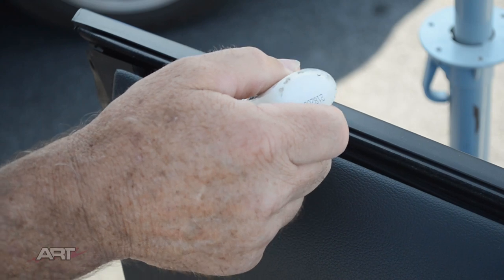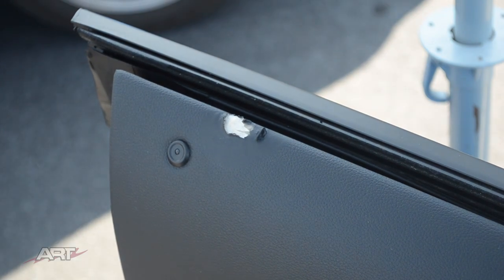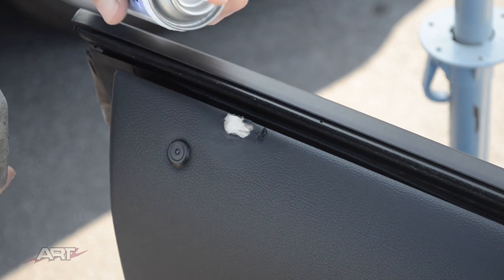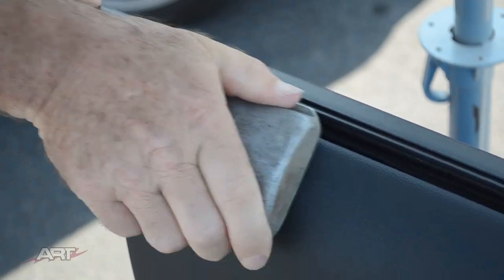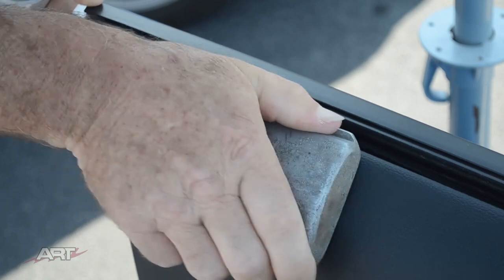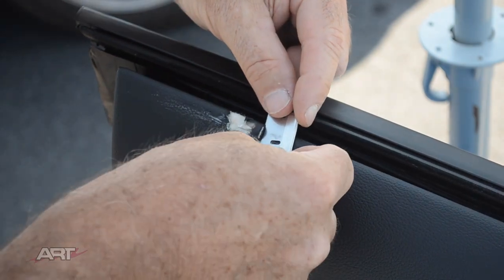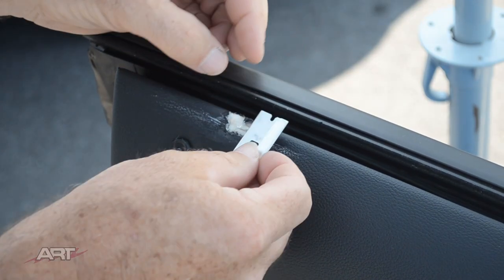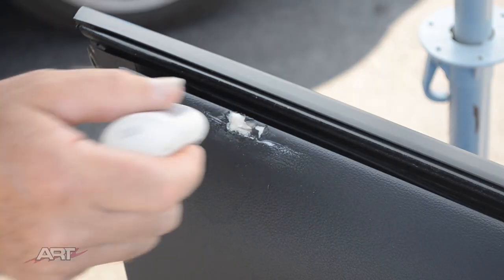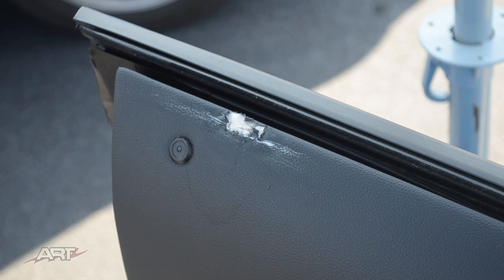The first thing I'm going to do is anchor all the bits that want to stay down. And for that, I'm using a clear, flexible gel CA glue. What I'm going to do is accelerate that and then hold everything flat. Now I'm using the chill bar. If I keep it moving, then the glue won't have a chance to stick to the chill bar. But I'm just keeping everything flat as it cures. And then anything that doesn't want to behave, I'm just cutting it off. And let's try more of the same and see if we can't get everything to lay down properly.